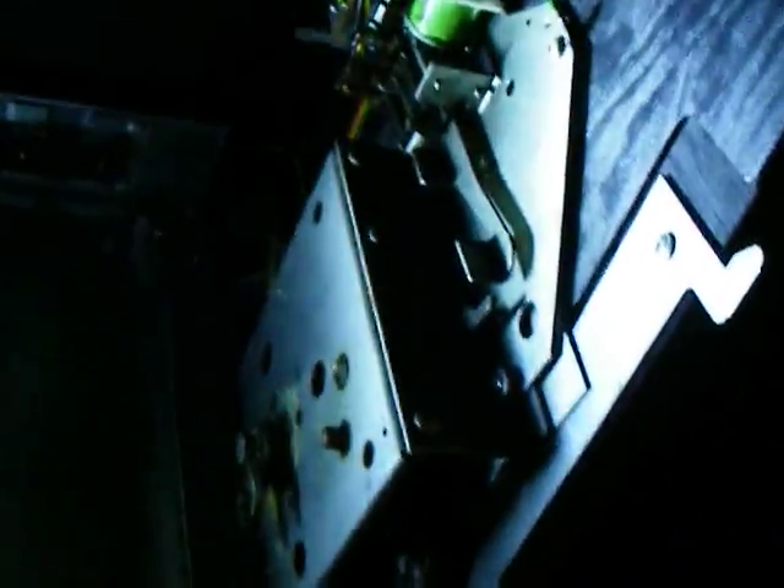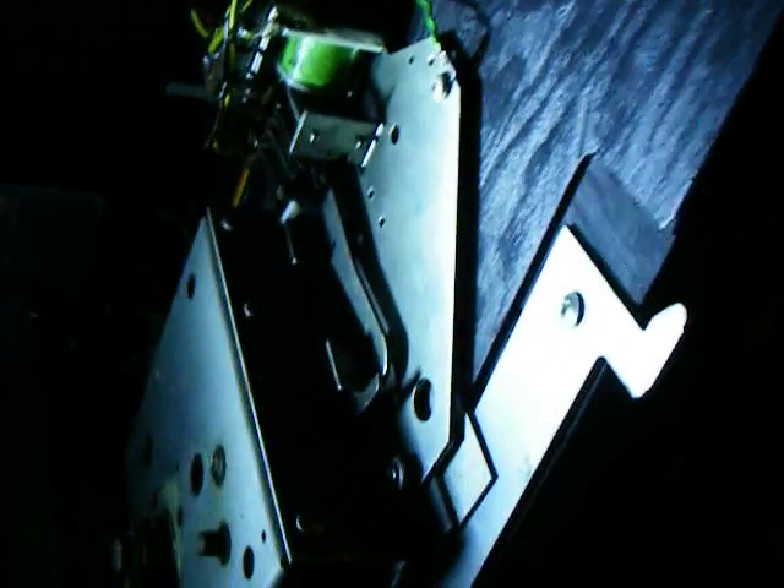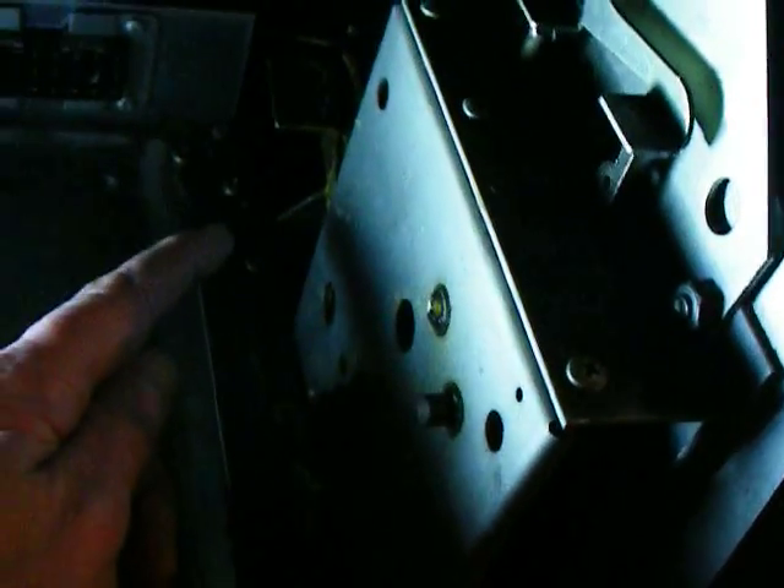This is a tool handle mechanism and it's released electrically by a solenoid up here — or an electromagnet is a better description — which then drops a lever and lets the handle pull across. But the handle cannot go back again until the coupling with the main mechanism that sits in here has released this little lever at the back, and then the whole lot resets.